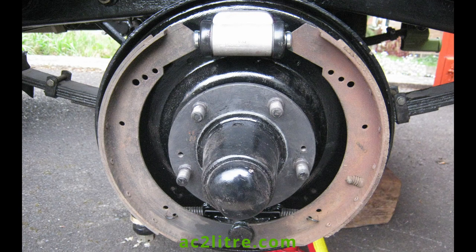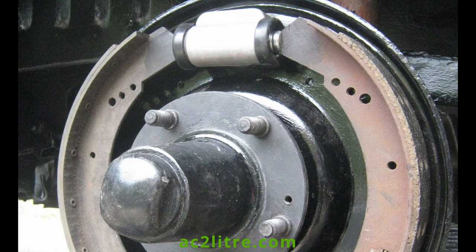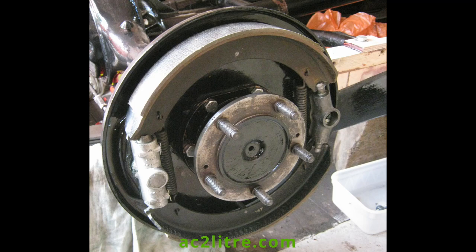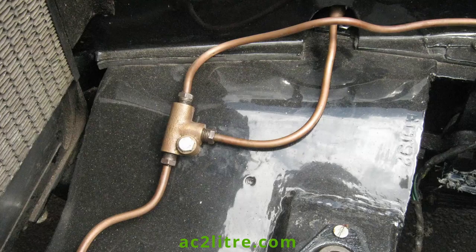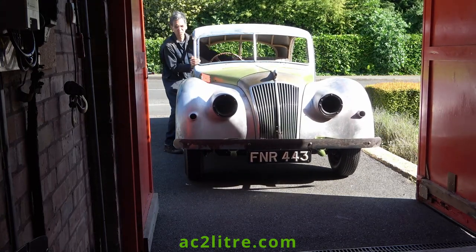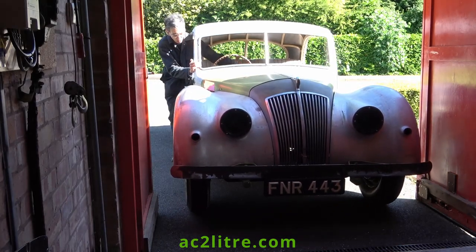Setting up mechanical rear brakes can make a big difference. Simply removing and fitting the shoes can involve some fun and games; the tension springs are rather strong and there is a risk of injuring your fingers when everything comes off suddenly. To remove the front shoes I pull back the top of one shoe, twist it so that the edge bears against the hub and push it upwards, stretching the spring until it comes out of the fulcrum at the bottom. For the rear shoes I use a strip of wood to lever the lower shoe off. When refitting I hang the top shoe on and then lever the lower shoe into place. With my car off the road I press the brake pedal regularly to prevent seizure, and I also test them to be sure they fully release and the car rolls freely. That's all for this braking adventure.